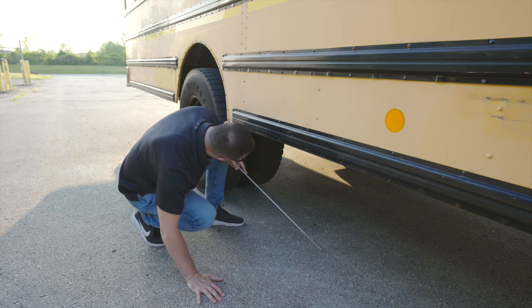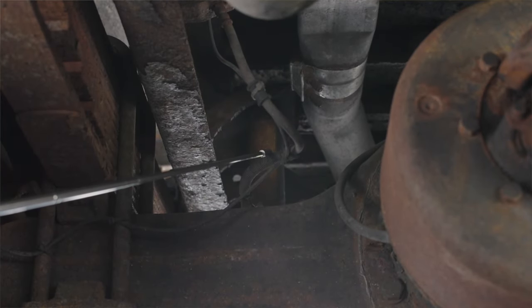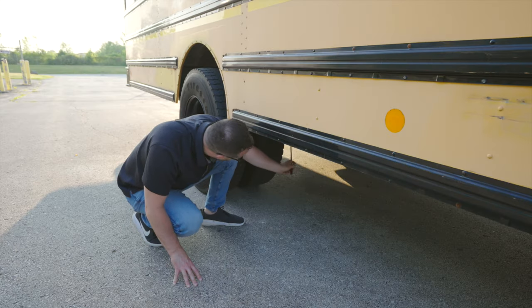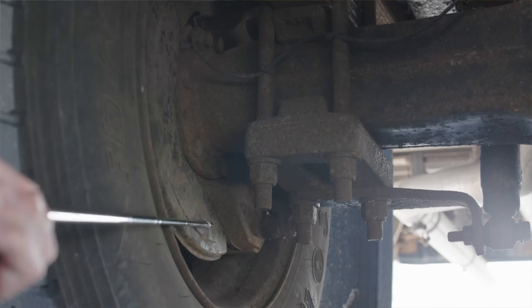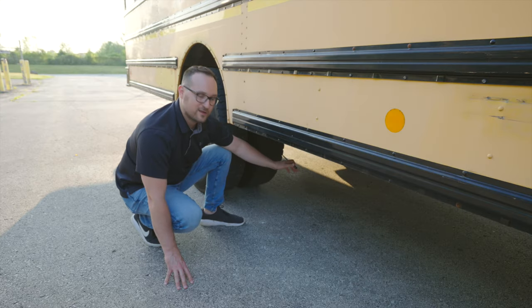After I do my suspension, I'm going to move on to my braking system. My brake lines and hoses, they're not broken, not cracked, unsecure. There is no cuts or leaks coming out of them. Inside my wheel is my brake drum. My brake drum, it's not broken, not cracked, unsecure. My brake pads, they're not broken, not cracked, unsecure. And they are not worn dangerously thin. They're adequate.